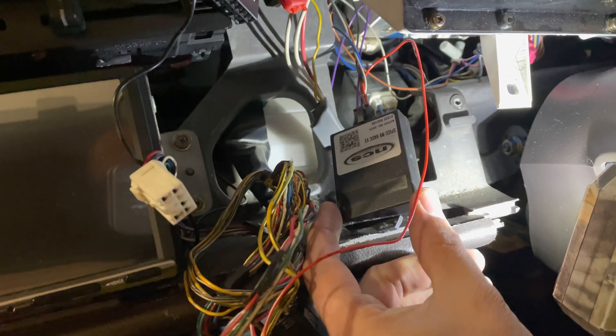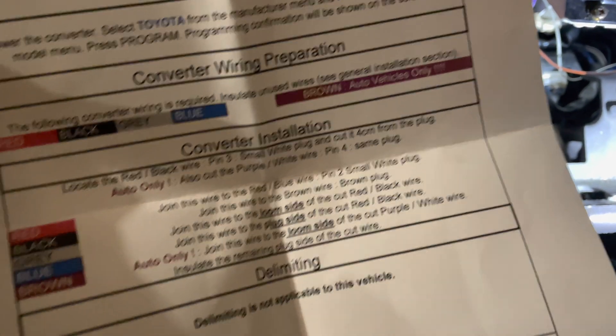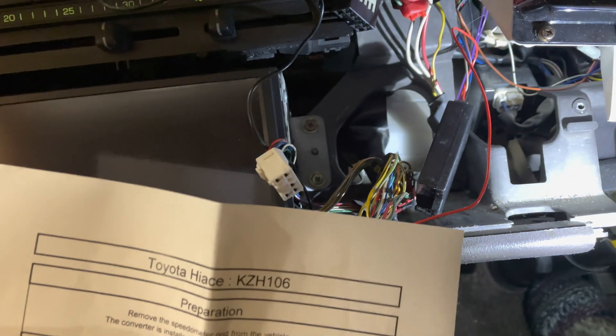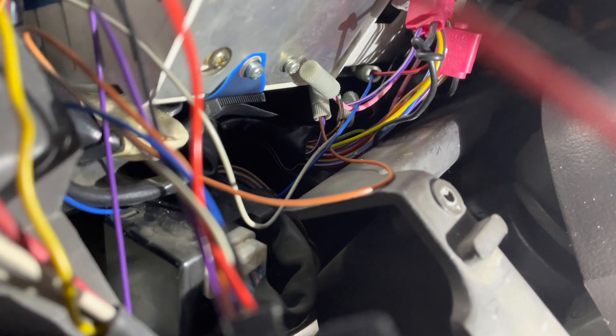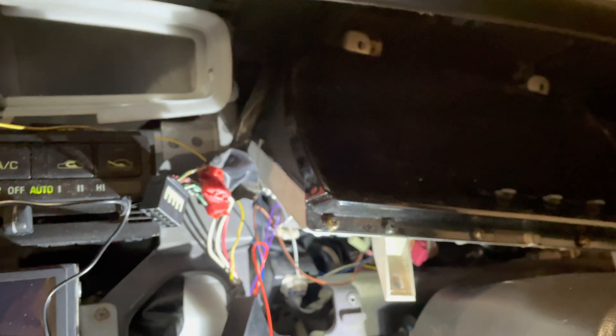Update on the wiring — it was really wrong. Do not follow the pins listed as three and four. Instead, follow the actual wire color: the red and black wire, and the purple and white wire. Looking at a different model, it's different pins but the same wires. I had to reconnect the wires I cut and just went by wire color on the gray plug. Everything works now.